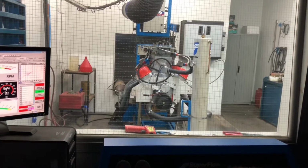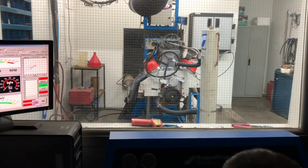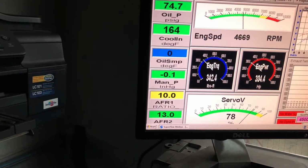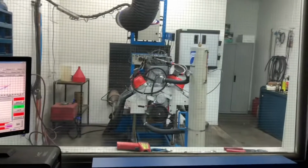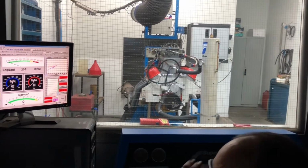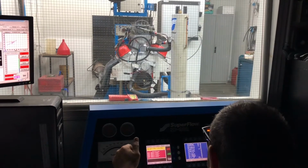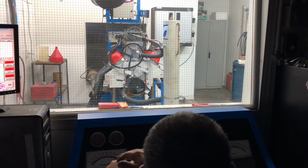We had water under the distributor cap, so they washed it off yesterday and put some new plugs in it. We'll see if it wants to pull. We'll find out. It's actually leaner now than it was. Yep, it is. When the engine opened the four barrel, it became very rich. But 2 seconds after, the engine is lean.